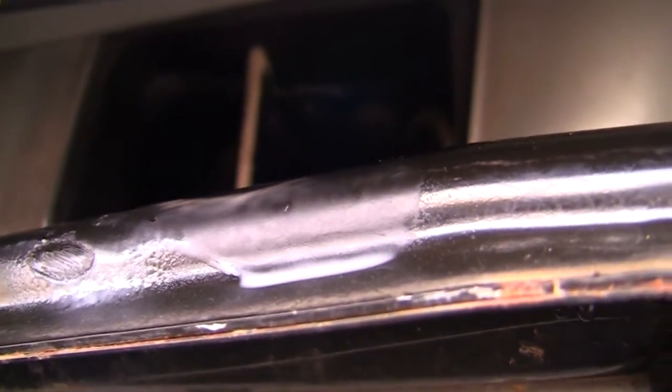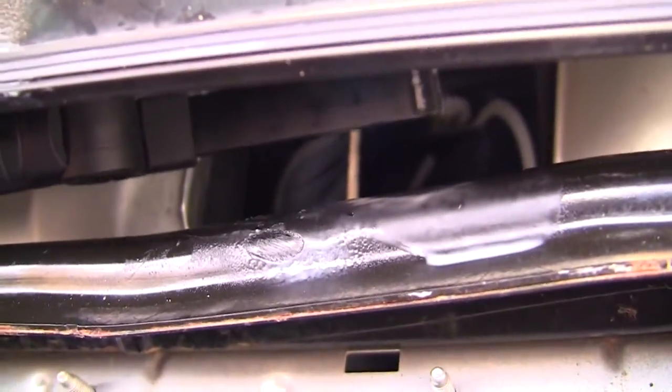You just can't see it, but there's a fan in there, the blower fan, and you can get to it. What you've got to do is get your airline in and just poke it in, and it'll actually manually move the blower fan round, and you can see if there's anything in there. And I had a piece of tape stuck in there, so I just blew around, and eventually I managed to blow the tape out and it came out of this vent, and I've got rid of it and everything sounds great again.